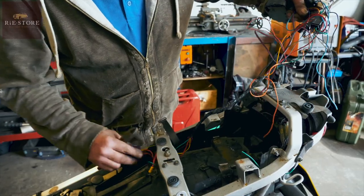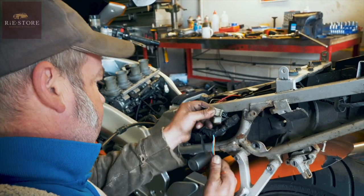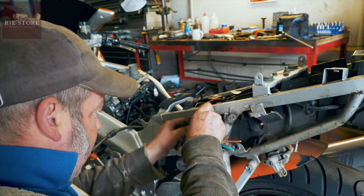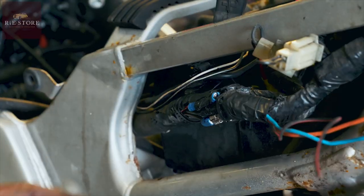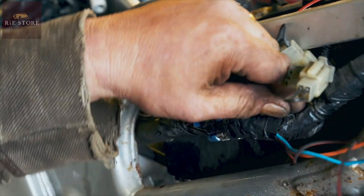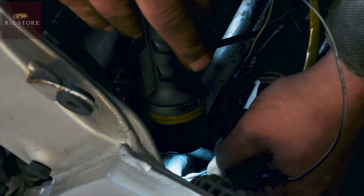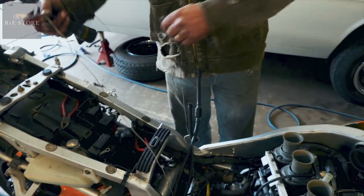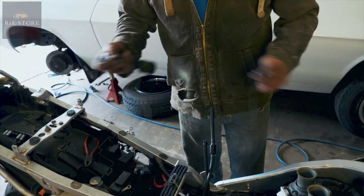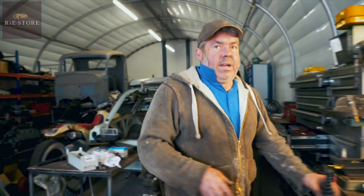This is what I think of bike alarms — in the shit pile. So those will all be for diagnostic pickups. This is why I hate alarms — look, that wire's bare. That could chase through and hit something and short out. See, that's the original wire to the fuel pump there, the blue and black. That's where they spliced it — gone up to the relay to tell it to shut out the fuel pump or not. So you cut those two off and rejoin them there. That's the worst of it out.